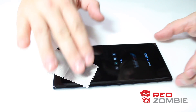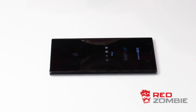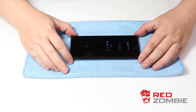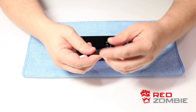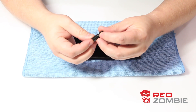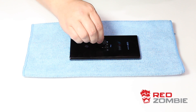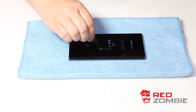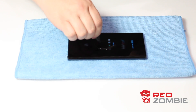Use the microfiber cloth to dry the phone. Next, apply the UV liquid — I recommend using a towel to place the phone on to make sure that everything stays clean. Grab the UV liquid container and unscrew the top portion. The best way to do this is to apply it to the center of the phone, making sure you use all the liquid. Try and keep all the liquid in one bubble — if you get different bubbles on the phone, that can create air pockets, which will make the install much more difficult.